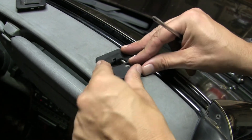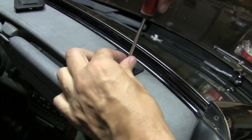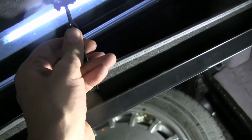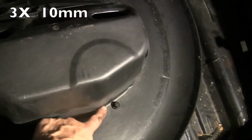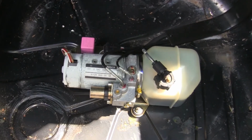Now, all of this leaking and testing since the beginning of the repair has probably left the hydraulic reservoir down a little bit from the top. So let's head back to the trunk, where under a plastic cover that's under the spare tire is the pump that runs the top hydraulic mechanism. Attached to this pump is a hydraulic reservoir that we're going to top up with some fluid.